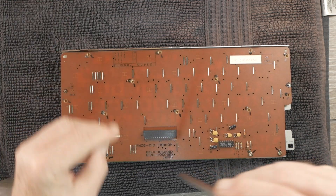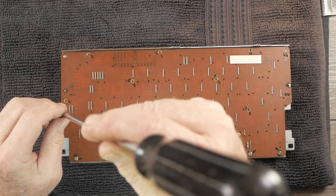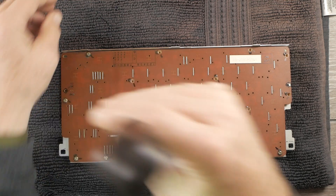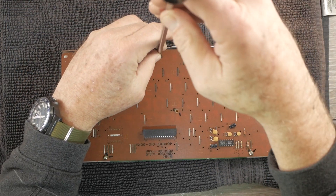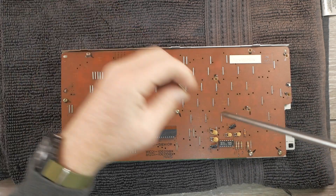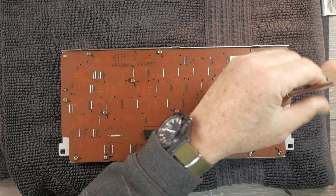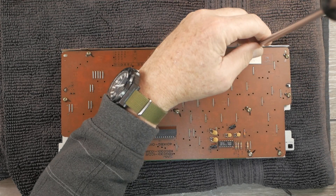Now I'm going to put this back together. We have the white male connector and the white female connector — line those up very precisely, get those pins lined up, and press the connector together. Now put in all the screws, because they could be securing a ground plane or connection on the other side of the board. I put each one in loose first, so the board has room to move slightly and you can get the rest of the screws in easily. The original screws had bluish-green glue holding them in — they clearly did not want these screws to come loose, likely because each screw may be a ground point connected to the chassis or circuit board. After all screws are in loose, tighten them all really well before testing.